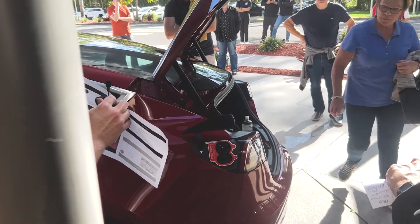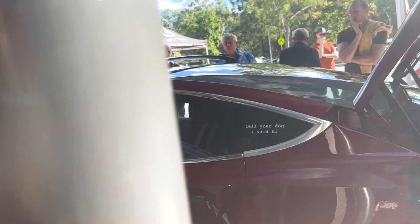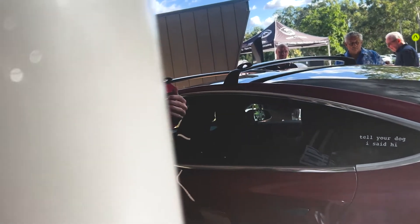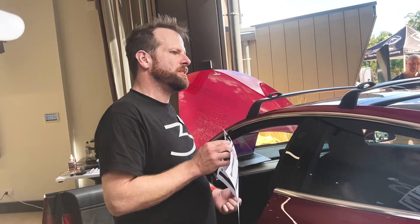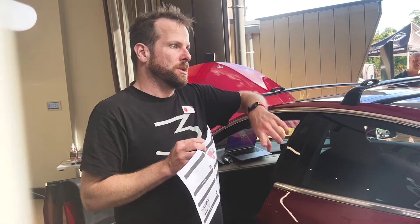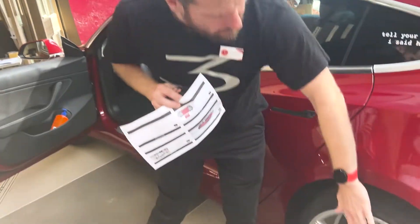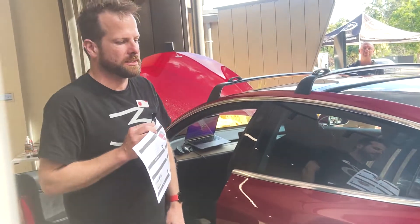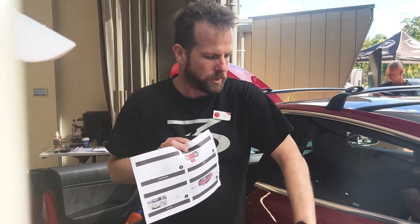The wheel covers on the newer SR with plastic covers over the whole wheel — the newer ones make it a bit hard to get to the tyre valves at a servo. You may have to remove the whole wheel cover; you simply need to be firm — put your fingers in the slots and reef the whole cover off. Putting it back, make sure you line up where the valve is with the little hole in the cover, and slap it on. Just put it in place and slap it with your hand — you just have to be firm.